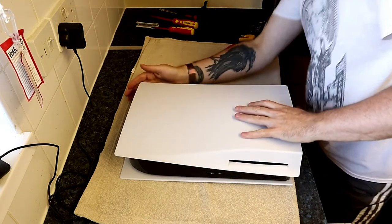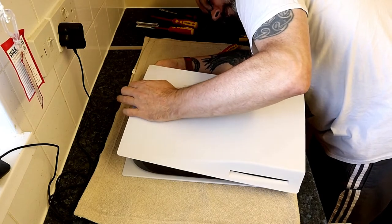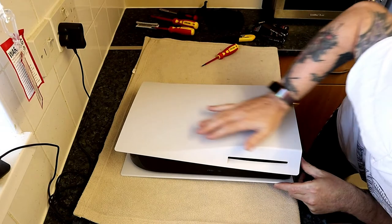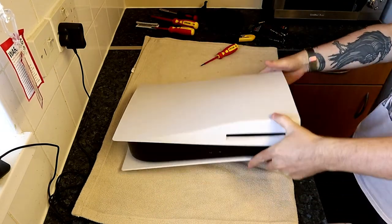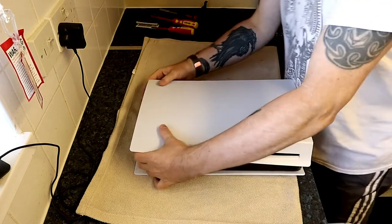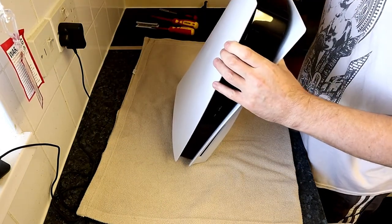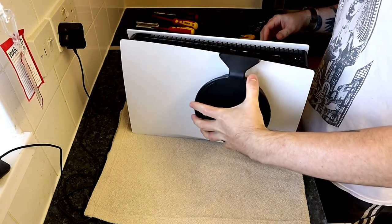It's just a very straightforward job. This only took about five minutes to install the hard drive. Once you open the compartment you'll see all the different locations for different drives and how to screw it in. Just unscrew that screw with the spacer — the spacer saddle goes underneath the drive — then plug your drive in and screw it in to secure it in place.